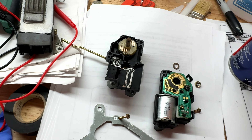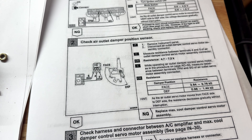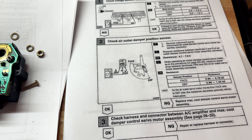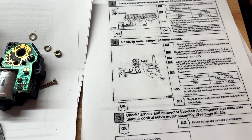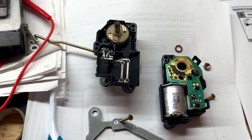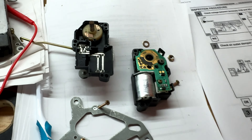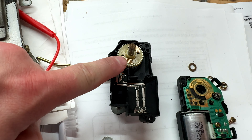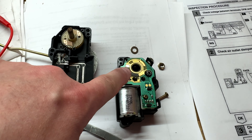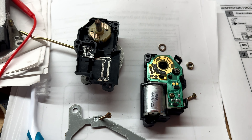They do have a procedure in the Toyota manual — this is the way you're supposed to check the resistance to see how this motor works, and that's where I ran into problems. I talked with my uncle, who is really into electronic repair and understands a lot of things like this where I really don't, and he told me to try using this CRC contact cleaner. I'm going to clean off these little fingers that provide the door position sensor, and he told me to also clean this with some alcohol — I have alcohol wipes — and just be as gentle as possible with these delicate electronic components.